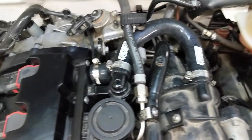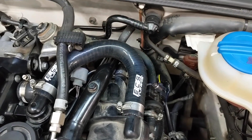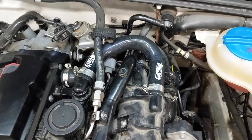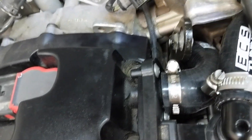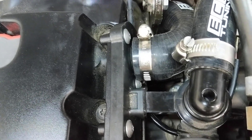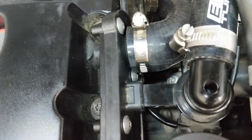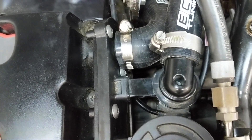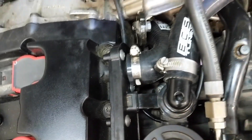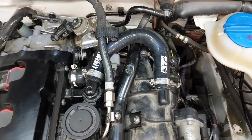The connection is quite good and things are all buttoned up. There are no kinks in the line. Once the ends of the hose are all seated fully onto wherever they connect, it's perfect — not a lot of slack but nice and firm, fits really well with everything surrounding it. I'll note in a small way that since the hose now comes over the top of the PCV valve, it actually kind of blocks one screw down there and makes putting the valve back onto the valve cover a little more tricky, but it fits just fine. I clocked the band clamp at the top, and the final fit and finish is quite nice.